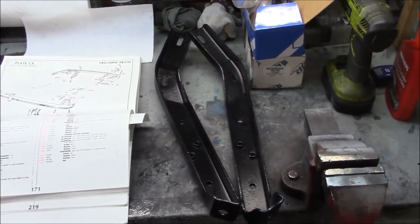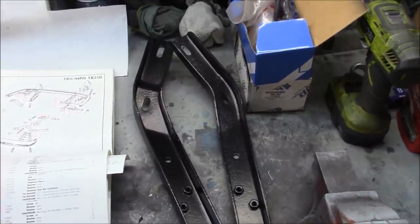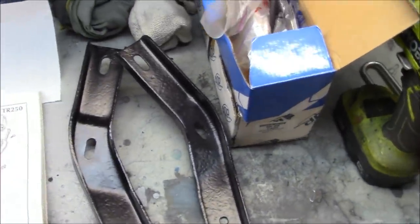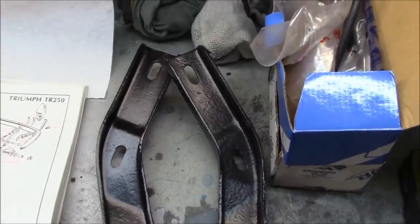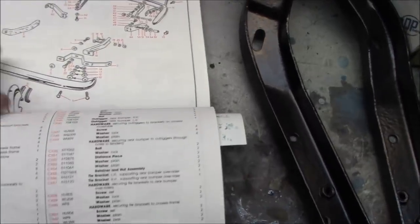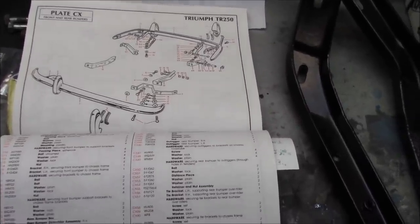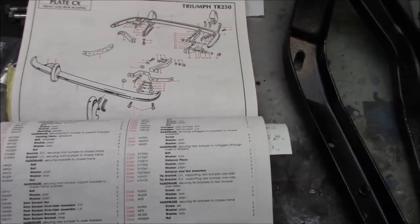We're going to add two big parts to the car just to get them out of the way. These are the bumper mounting brackets that go on the chassis and attach to the sides of the radiator protection shield underneath the car. I do not have the hardware for these two locations because I had to grind and punch it out of the frame — they were rusted solid. I want to do a little section on what you do if you don't know the factory hardware. What I normally do is use the spare parts manual for the Triumph TR250, which utilizes factory plates. Roadster Factory and Revington TR also have the plates displayed.